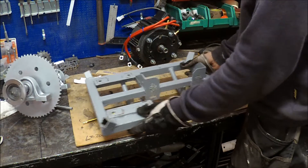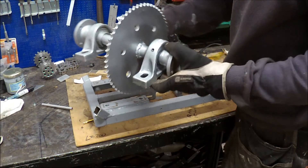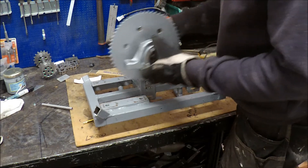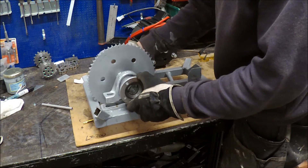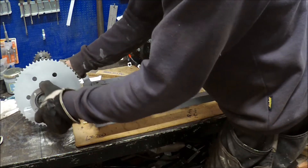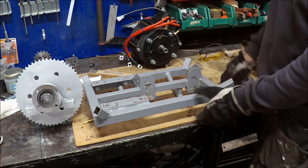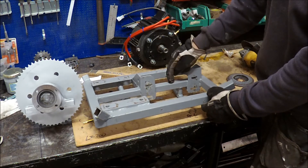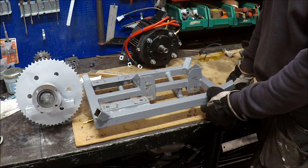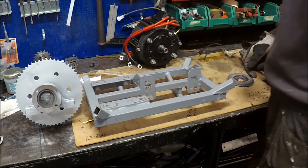I just cut the subframe away from the rock roller and here is the new drive shaft. As you can see here, I have to cut into that one and also make new flanges so I can raise it a bit. I also must modify these two because this 1304 motor is a bit bigger in diameter and it touches these. I can't get it into position so I must cut here on both of these. I'm going to start by making new flanges and then cut this and make some reinforcements so I can get the sprockets in there.